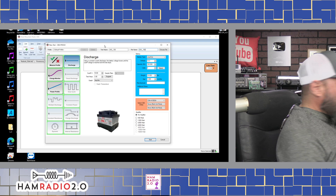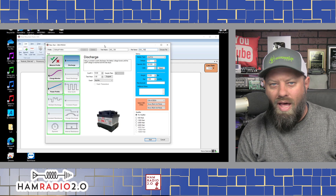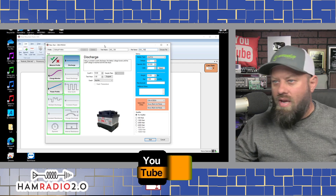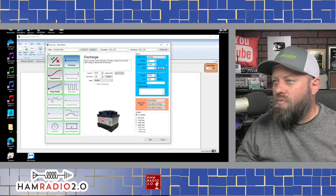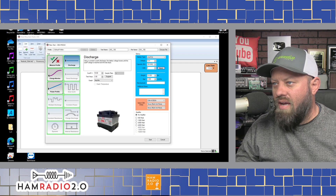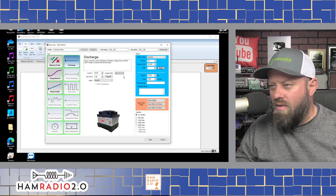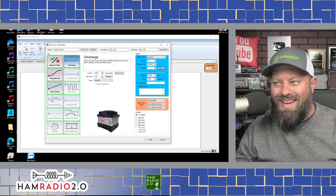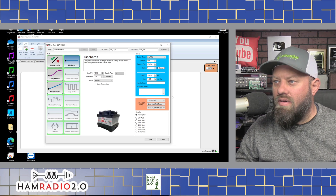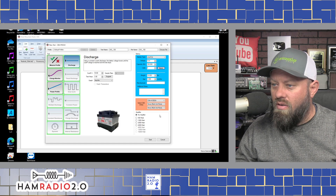I did notice that the top of the battery has a red post and a blue post. The negative terminal is blue instead of black — strange, but okay. Let's click Detect here. It detects 13.4 volts. Capacity it doesn't detect; I always set that myself. Cells is number four. The weight and age are settings from a previous battery that don't apply today, because the only thing it really detects is the voltage. This comes in at 13.4. I charged this last night, so I know it's topped off and we're going to get a good test.